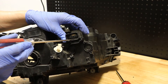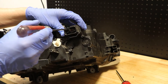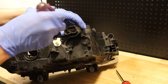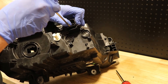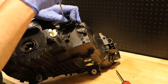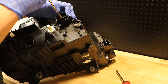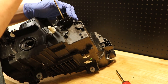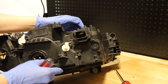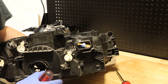In order to release the main wire connector for the headlight, I need to get a flathead screwdriver on the bottom and then on the top. There is a clip in the rear, so I need to push a flathead screwdriver in and push in with my thumb on the connector. With those two clips released, I have pushed the connector into the headlight.